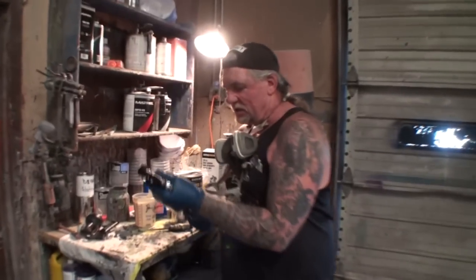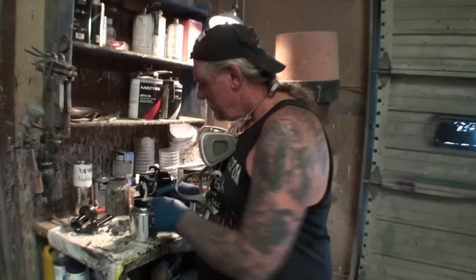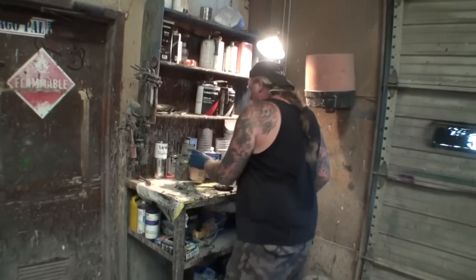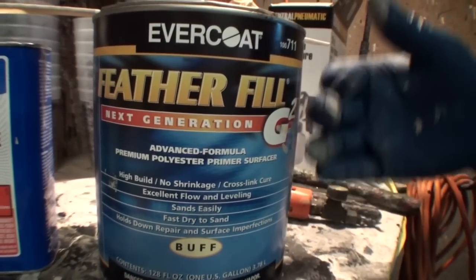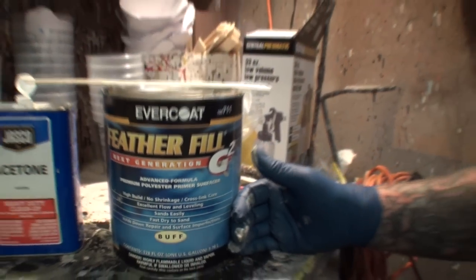What you would normally do is take your time, completely dismantle it, tear it apart, and clean it up. But this is a production shop — I don't have time to clean a $20 spray gun. If you're looking for a gun to spray super thick filler primer — not Slick Sand, not spray-on bondo, but a super thick primer — this is it. You can also spray spray-on bondo like Slick Sand, or there's another product by U-Pol called Re-Face. This is the gun I always use — $20 at Harbor Freight.